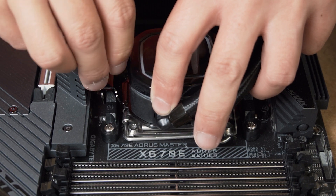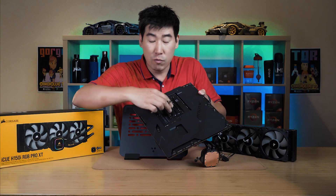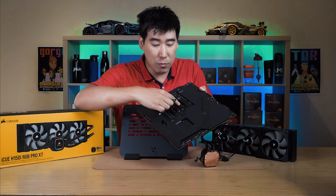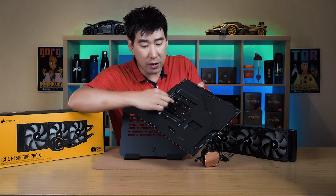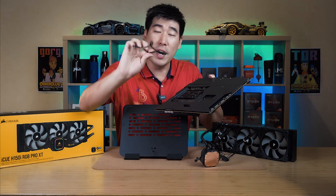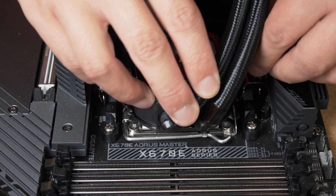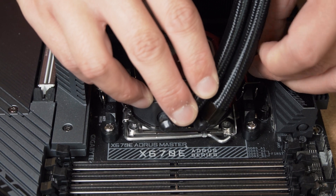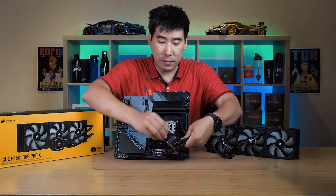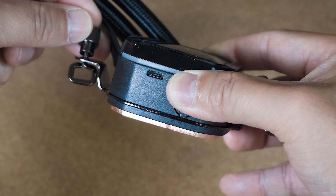You can't install any custom bracket that requires you to flip the board and remove the backplate, as you can't remove this backplate at all. Once you move past this area you can see it only has four screws and that is actually for the socket itself. So you can't install any custom ones like that — you need to use coolers that have these brackets with two prongs that open up, with a lever-hole style mounting that allows you to screw it in.